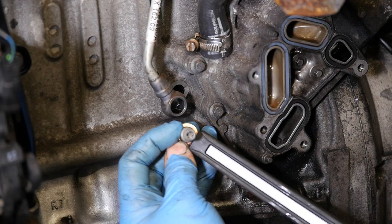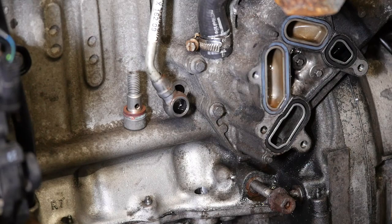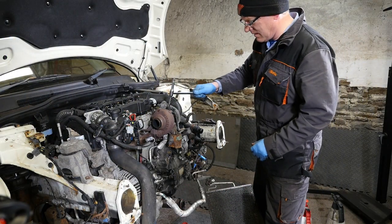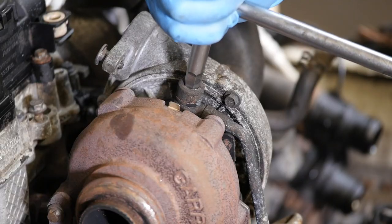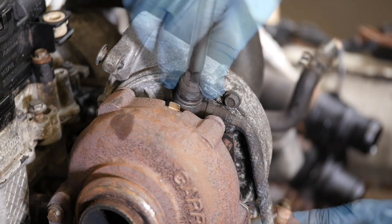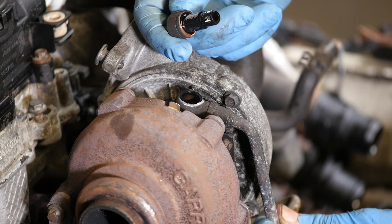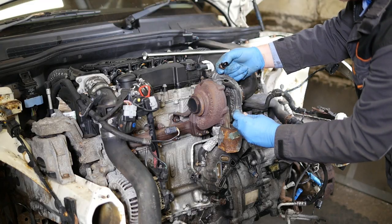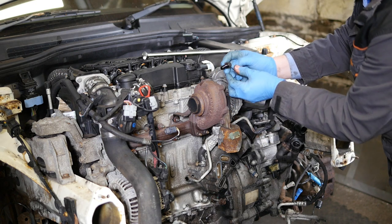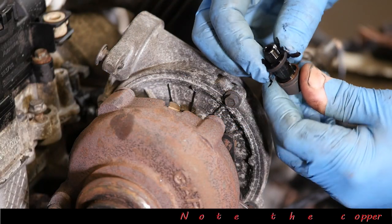Like I said, that's sort of good for the fact that the car perhaps has been serviced, but it makes it even more peculiar why we should have a top end issue if everything's been serviced. I'm going to take the top off now — that's again a 10mm hex key — because obviously I want to check that the pipe itself is actually clear as well. So I'm going to remove this pipe and I'll blow compressed air down it just to ensure it's perfectly clear.